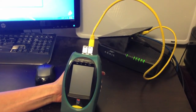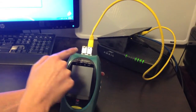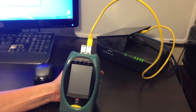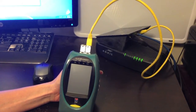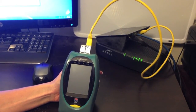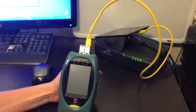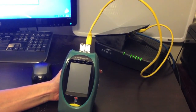Lastly is independent mode, where each port of the LANXpert is connected to two different ports on the network. In this configuration, each port on the LANXpert is assigned its own MAC and IP address. This configuration is mostly used for generating traffic from one port to the other using the RFC2544 stress test to stress the connected network.